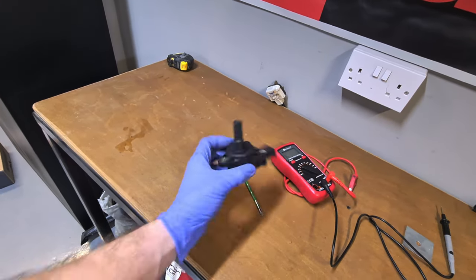What a fantastic car a Mercedes is to work on — it took literally less than 30 minutes to diagnose and repair that problem. Luckily I got to the faulty coil first. Now if you ever have this problem with your car, it doesn't necessarily have to be a Mercedes — every car will develop a misfire due to the coil packs or spark plugs at some point. Get yourself a voltmeter and give them a test. Hope this helps and I'll see you next time.